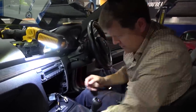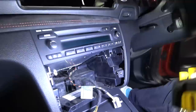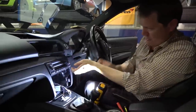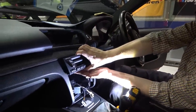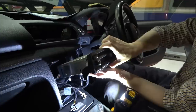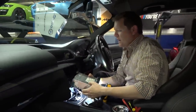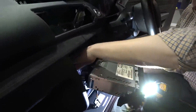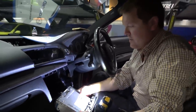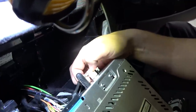Now we're able to access inside here and get to the back of the head unit. After removing a couple of screws that hold it at the bottom, this should now slide out — straight forwards and out. I don't remember it being so easy back when I was trying to do this with no idea what was going on. So let me work out what space we need and where I can delicately place this to be able to access the right cabling behind.